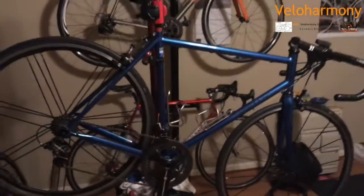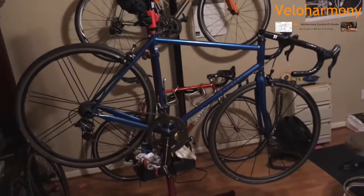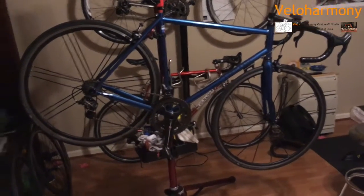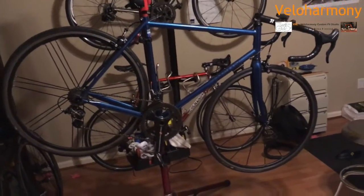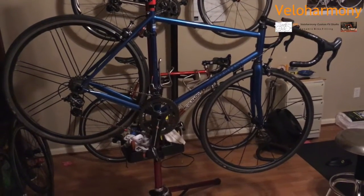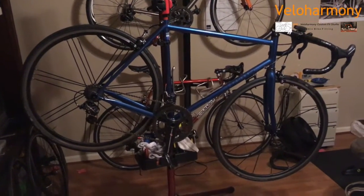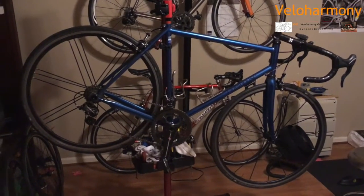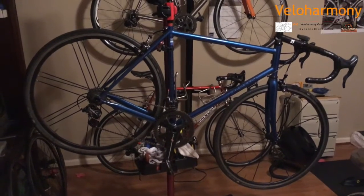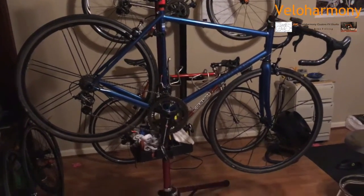What I wanted to talk about — I think what would be more interesting — is the sizing on the bike. This blue bike is a compact frame. It has a sloping top tube. This is a 51.5. Basically with a compact frame you can use a smaller frame. I usually ride anywhere from a 55 to a 57, center to center, from the center of the bottom bracket to the center of where the seat tube meets the top tube.